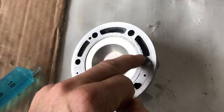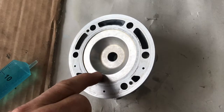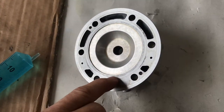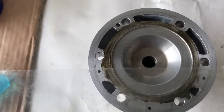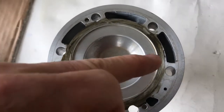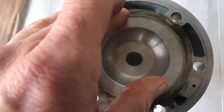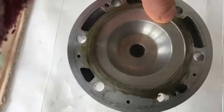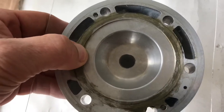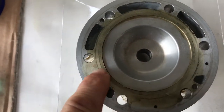So now I'm going to take the plug out. The plug is out. Now what we're going to do is get any old grease and put a little bit of grease all the way around the lip here — not actually in the combustion chamber, but just on the surface that contacts with the cylinder. Just ordinary engine grease. Wipe out any that gets into the combustion chamber because we don't want grease in there. Then we gently put your piece of glass on and push down on it. The grease will form a seal. Make sure it's completely sealed all the way around, then we can go to the next stage.